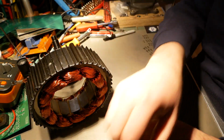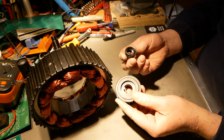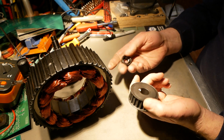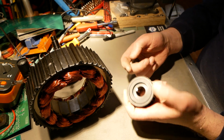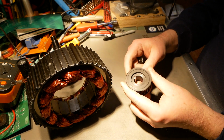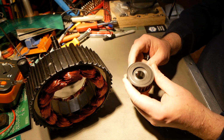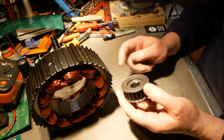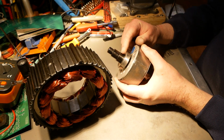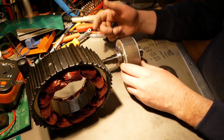One other little detail. I should have brought this up in the fit and finish video. Here is your nut and sprocket, or pulley. Just like the V1. It's the exact same hardware. And again, the key was too short. So, go figure. I pulled the old key out, put that in my box full of keys, found a longer one, and filed it off so that it was going to fill that keyway completely. I don't know why they put a keyway that only fills at 75%.